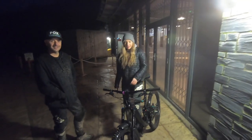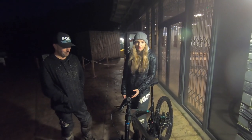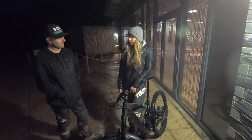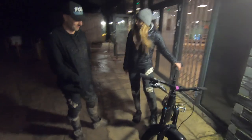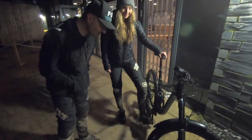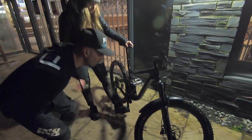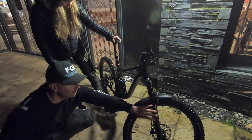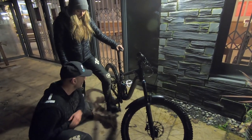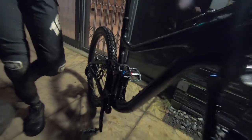That's the end of the day. It's been absolutely awesome seeing how the suspension has changed and just the feel of the bike getting down the trails — absolutely so impressed. Dave, do you want to give a little rundown of what you've done? To cut a long story short, based on looking at the data each run, we've ended up with more pressure in the forks giving more support, we slowed the rebound down a little bit to make it balance with the rear, and we've put way more pressure in the rear shock to make the back end more lively.